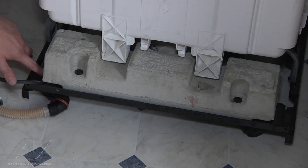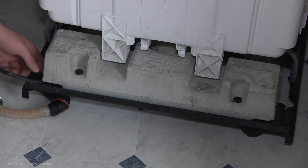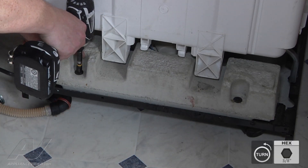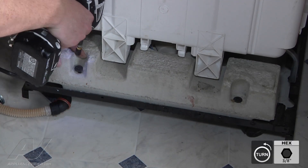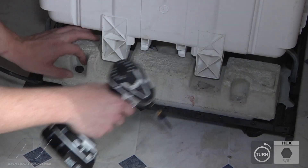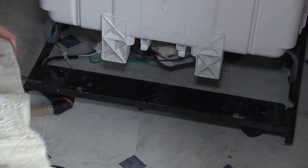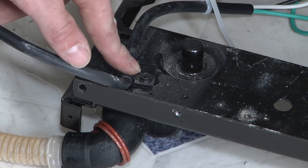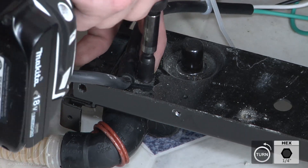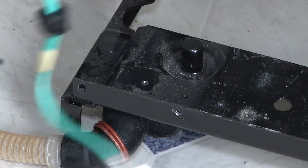You have an anchor here for the power cord. The bolt is underneath the weight so it's not a very good way to get to it. So you get to remove the weight with these two 3/8 sockets on each side. Then you lift your weight up and pull it straight out. Now you can access the support screw here. You're going to remove that with a quarter inch nut driver. That frees your power cord so now you can pull it through.